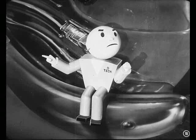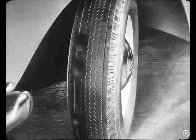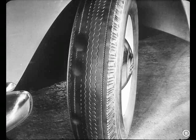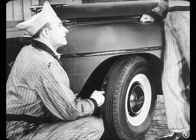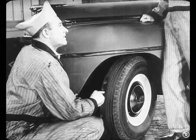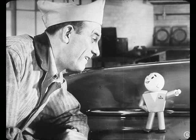Yeah? Then let's hear him read this chapter. It's easy, Joe. Flat spots may become troublesome after about 3,000 miles of driving, and they appear only on front wheels that don't drive the car. If this is the only kind of wear showing on the tread, front end alignment is the last thing we have to worry about. You better tell them about those tests, Mac.